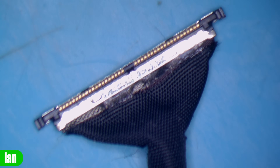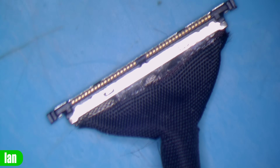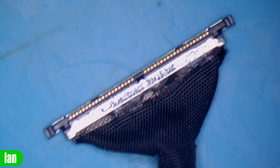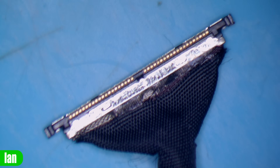Just taking a closer look at that MIPI connection. Whilst it looks similar to what we had on the original DJI FPV system, it is actually a larger one. The original FPV system had a 30-pin connector with 15 each side of the centre, whereas this is a 40-pin connector with 20 each side, which means they're not compatible.